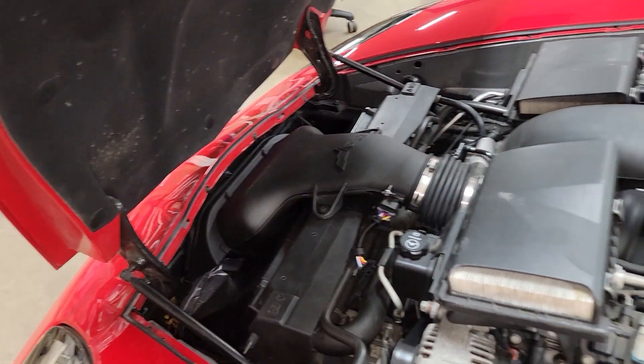Finally — and this is absolutely subjective — I just think the LS7 air intake assembly looks much better. So what are my recommendations? I'm kind of on the fence about doing this as a standalone modification, because the main benefit on a stock 400-horsepower LS2 is clearly obtaining that colder air. If you can tune it yourself or have the tune done cheaply, and the parts come in at about $260, I think I'd go ahead with it. That said, this modification clearly makes the most sense when performed in conjunction with another modification like adding headers or a camshaft, so you can tune everything one time. I hope you found this series of LS2 air intake videos entertaining and beneficial — thanks for watching.